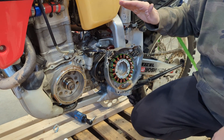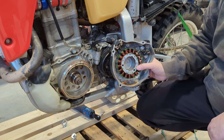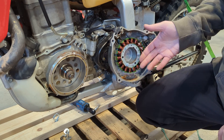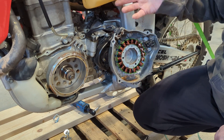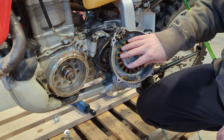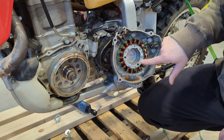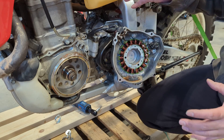Let's talk about how you install this. The stator installs just like the original. You can see on my bike this was running an early prototype — I had a grommet that leaked so there's some rust to clean up, but I ran this prototype for a year and beat the crap out of it and it didn't fail even with rust. To install, pull off your side cover — four eight-millimeter bolts. Remove your old stator with three eight-millimeter bolts, your pickup coil with two eight-millimeter bolts, and your wire clamp.